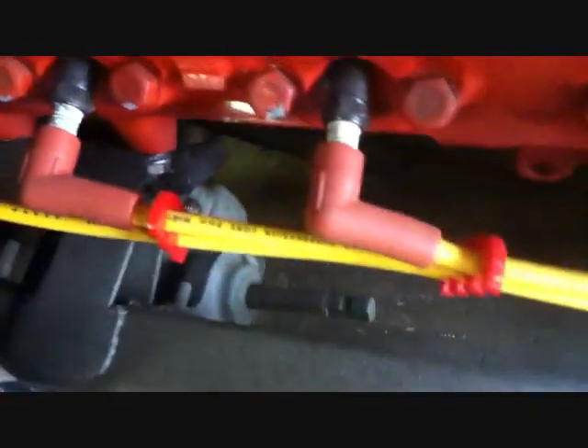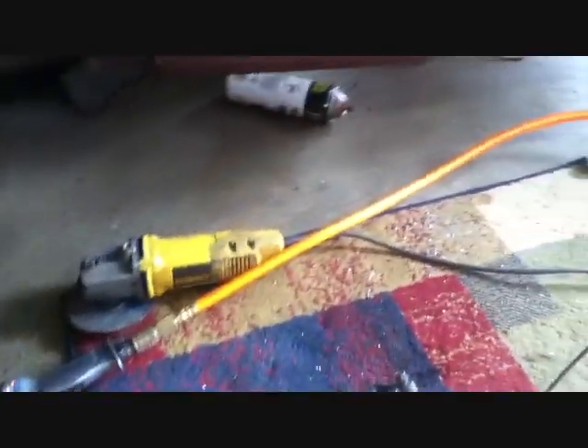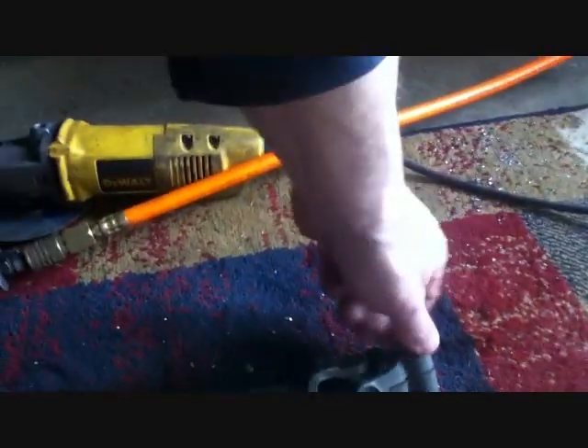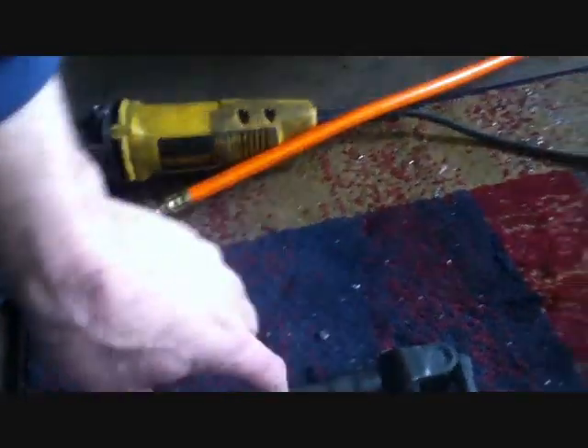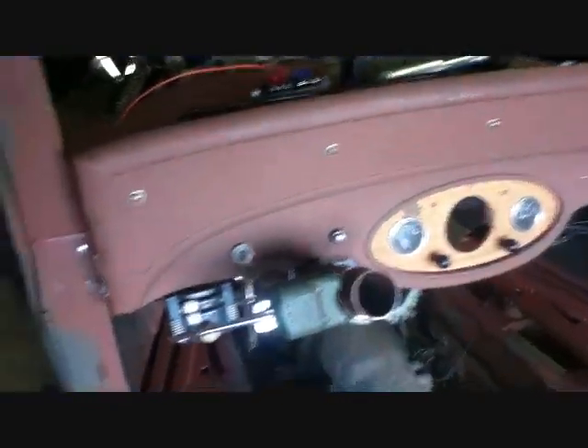The bearing's floating out and that connects to my steering box which has the 19-spline. Jeep Laredo — and I don't have one, I have like three. Every time I've seen a Jeep Laredo I would take it out — it was like an 11-millimeter nut. You take this all the way out and then it just slides off. You've got to heat the middle to get that clip to separate, and when I get the length I need I've just got to put a little weld there. I'm looking for more goodies to put on. I'm going to put a newer stereo under here but it's going to be set back — you're really not going to see it. But I've got to charge my iPod.